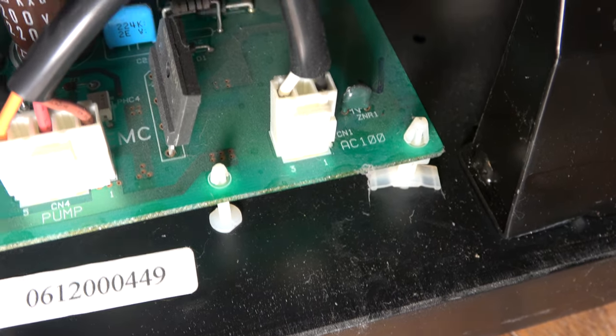I need to measure very, very low ohms, looking on the board for this short circuit. That's my probe resistance. I'm running in 2-wire mode. I don't have a suitable 4-wire. So I'm using a high-quality multimeter here with more resolution than an ordinary one. So I can go down onto the board and look for the lowest possible resistance between paths, looking for this 5-volt short. And I might be getting somewhere. So let me do some work off camera and see if I can find where the short might be.